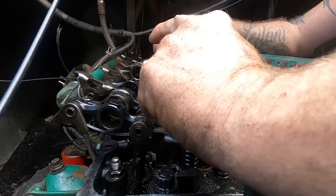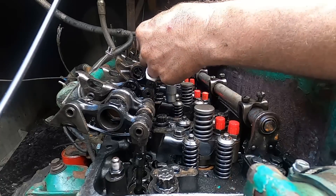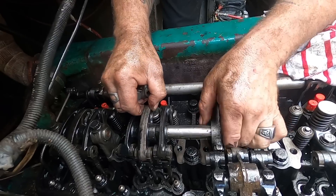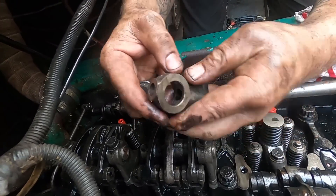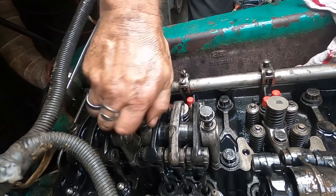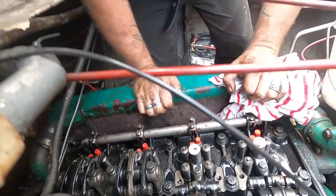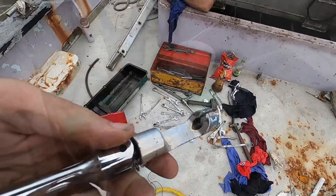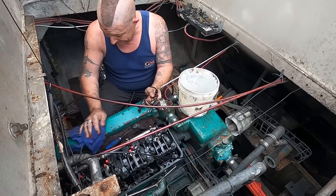We don't have a torque wrench — Adrian forgot it. So we're going to do the elbow method — over the years you get a feeling of what 25 should be. Same as the 71 and 92 — they've got a nice machine side, unfinished side, finish side to the rocker. These are 45 foot-pound. This is the special fuel pipe socket — makes that job a little bit easier. No valve clearances, no injector heights — we're just doing a bit of a quick fix, it'll run, it'll get us home.